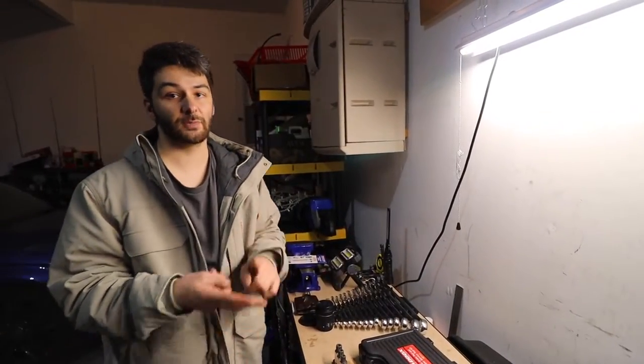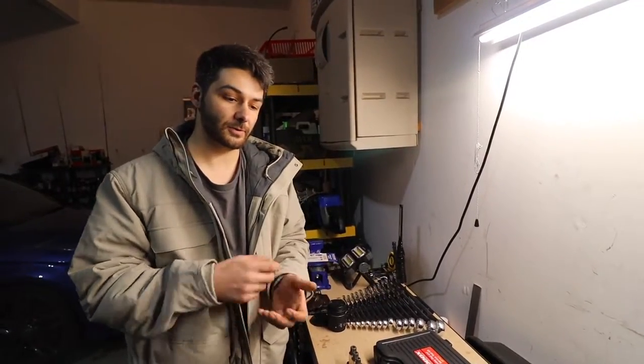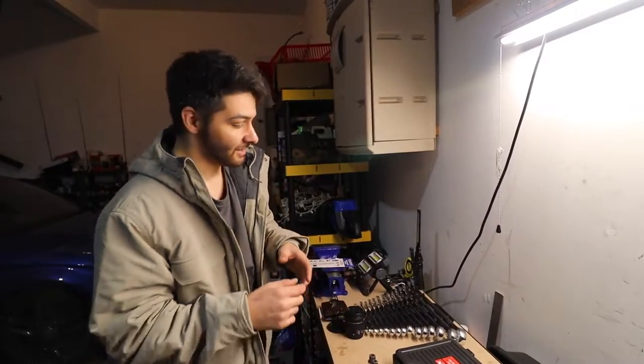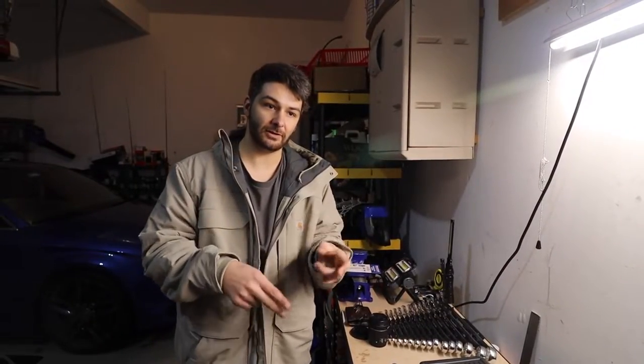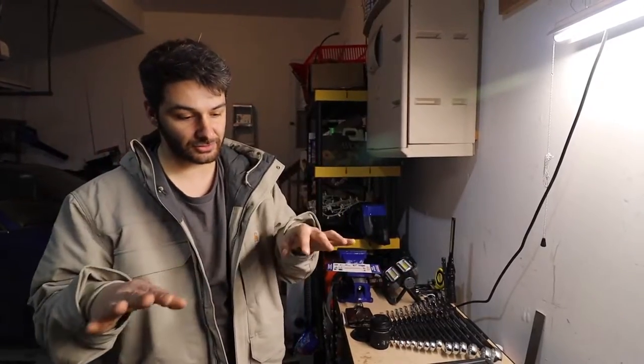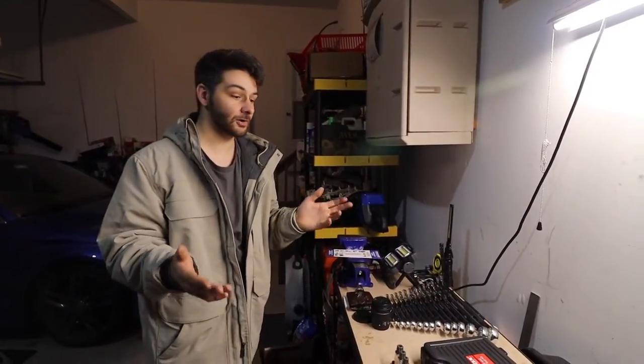Also, there's a thing called OBD11. It's about 80 to 100 bucks. You plug it into your car and you control it on your phone. You could disengage that parking brake. Or, I don't suggest this, there is a little ghetto way. You could take off the motor, put a battery, and then put two wire leads off it, and you connect the pins to the rear motor and it will disengage it. It's a cheap hack, and I don't suggest it because some things can go wrong.